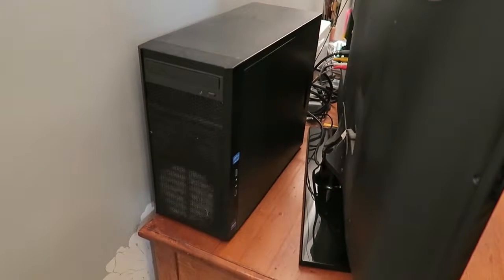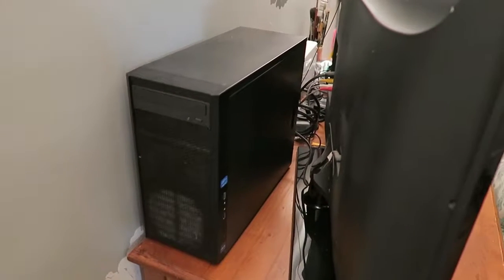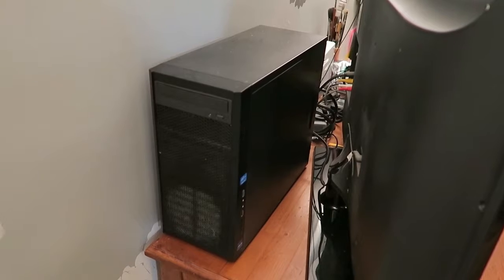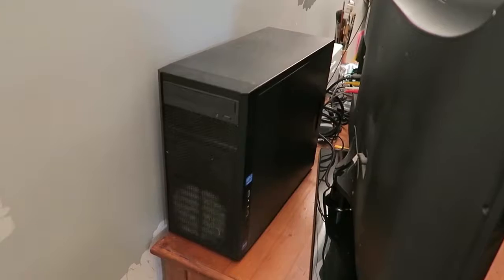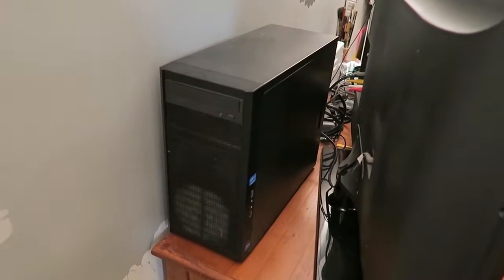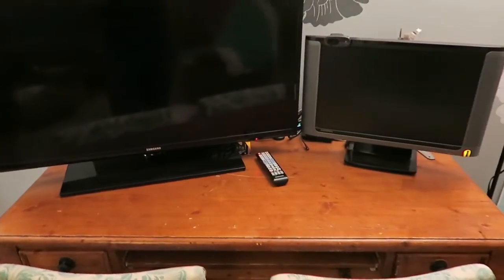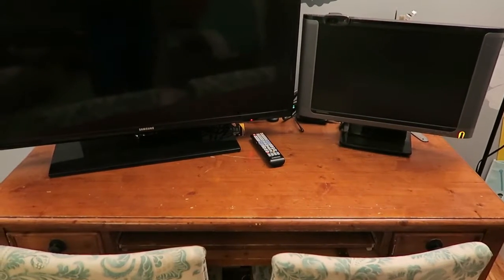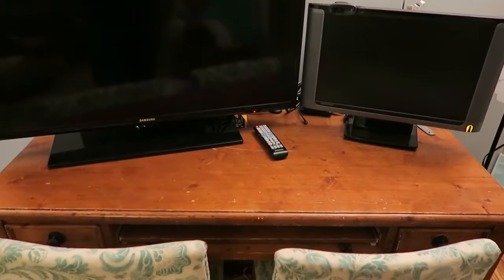Here's the computer on the back. For years now, as long as we've had this, we've been blowing out the fan here as well as the couple of fans on the back. I thought that was sufficient, but looking into the computer I realized there were quite a few more fans than that. What really woke me up was getting a low chassis fan, low RPM warning — that made me realize something was going on.